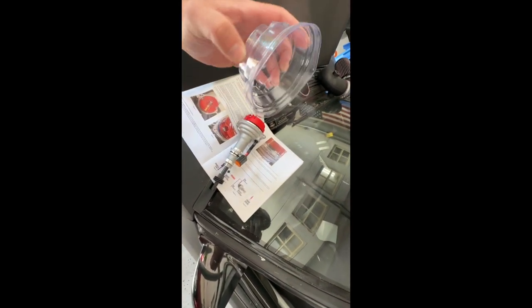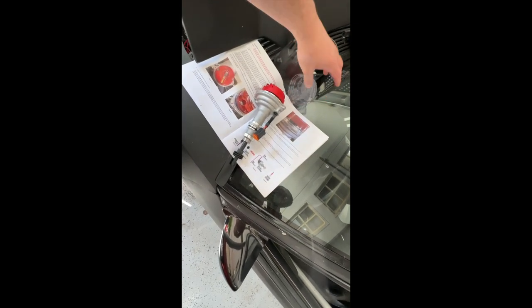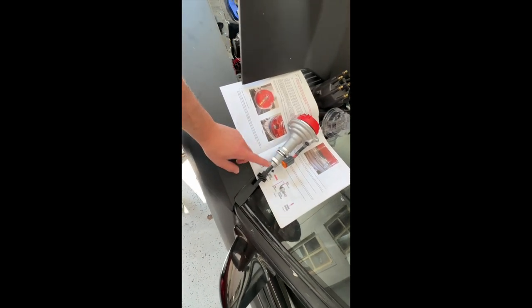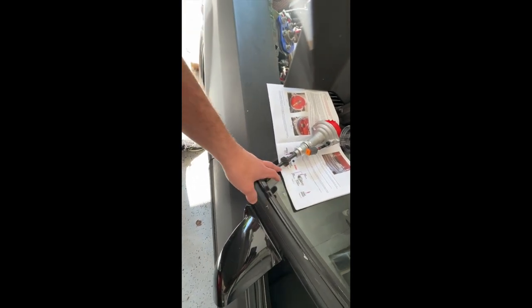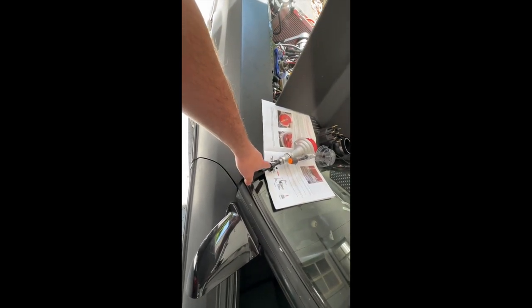Right now TDC is pointing roughly toward the radiator hose, so we'll line the rotor up with that for number one. It doesn't matter exactly because you then take the clear phasing cap, spin the distributor until it locks, and there's a little nick in the cap — you mark that with a sharpie and that becomes your new number one spark plug wire location. Install the wires from there. I've installed the O-ring gasket. Note that the distributor will spin counterclockwise due to the helix of the gear, so you may need to go back a tooth so it lands in the desired position at TDC.